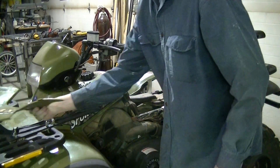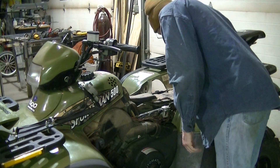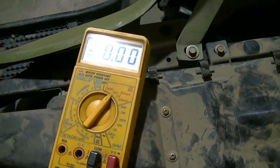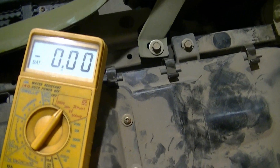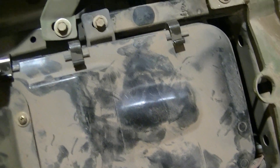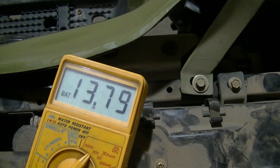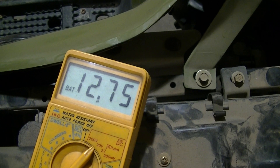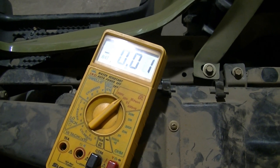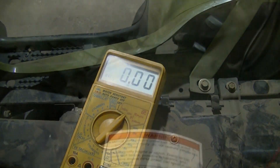You've got to be a little rough with it to get it off. Then I'm going to check the starter solenoid with the voltmeter. First thing I'm going to do is hook the voltmeter to the battery — got the negative on there, the positive on there — and make sure you've got 12 volts at the battery. Looks like it's got over 13 volts, so the battery is good.